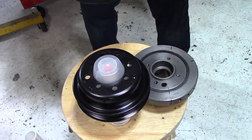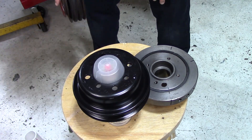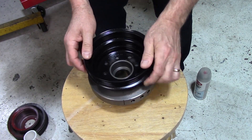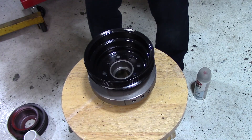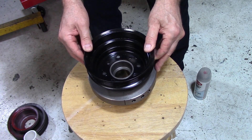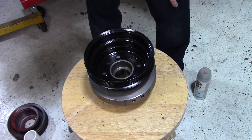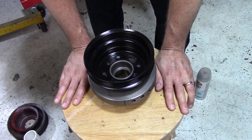The difference between the Oldsmobile pulley and the Ford pulley is somewhere around 65 to 70 thousandths. I drilled everything out and when I put it onto my balancer the holes line up. I used an old feeler gauge — the kind used for old points, really tiny — and checked all the way around. It's 32 thousandths the whole way around. It might be a little snug on one side and a little loose on the other, but there's wiggle room even with the bolts in. I think I can put something in to space it out perfectly. It's in the ballpark — that's my solution.